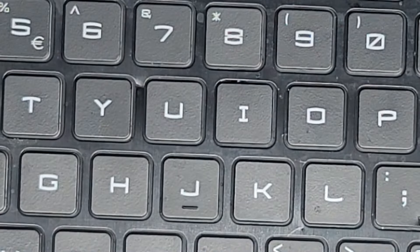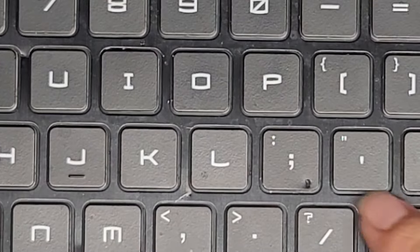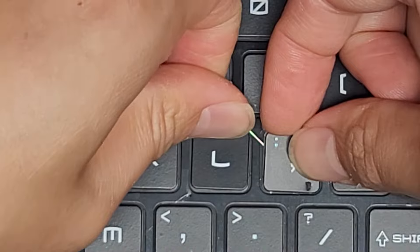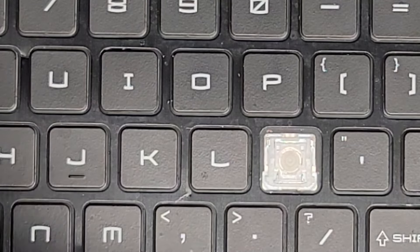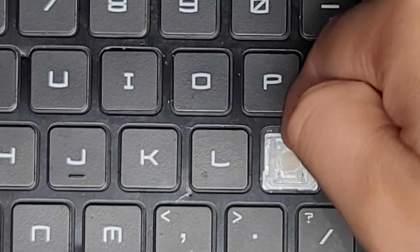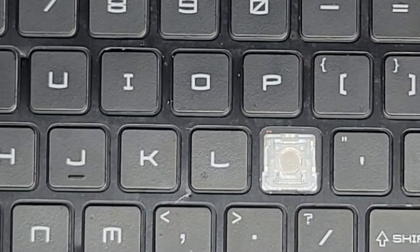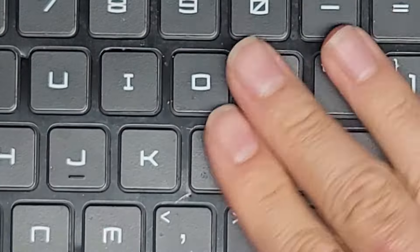We had this other key that was also damaged. I'm going to remove it from the top this time — normally I don't work on the laptop sideways. You can see the giant dent there. I lift it up, locate the center, slide the needle up towards the top, work my way over, pop both out — and there we go. Nice and simple. We're going to do the same thing with the shift key. I think the hinge was okay. It looks fine. Let's clean this out a little since we have it open. Start with the bottom, work your way up, click that into place.